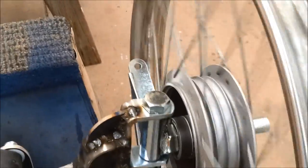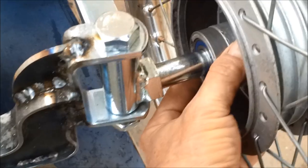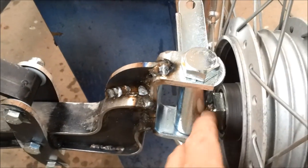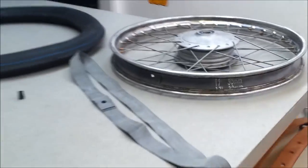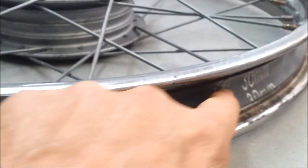I got the cart inside because it's kind of cold outside in the workshop. So I put this on here — that looks pretty good. These spindles tend to be a little on the long side. You could put a spacer in here, say an inch long, and that would bring it right in line — which is what I've done on my other carts. It works alright, but the steering is better when these are up tight against this shoulder here if possible. I'm going to put the tires and tubes on these front rims now. You really need to use brand new rim strips — they're a couple bucks a piece. They cover the spokes so they don't poke a hole in the tube. If you don't use these you're asking for trouble — you'll just have flats all the time.